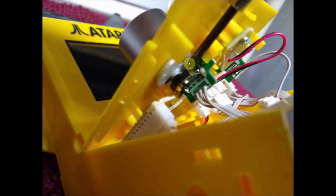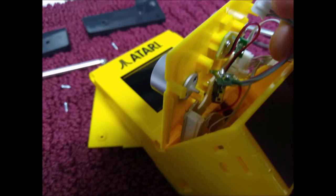And then I used a flathead screwdriver to slowly pry this down. Now what they did here, again, I originally tried to pry this off because I thought it was a clicky potentiometer, which it's not. It's actually screwed in from the bottom, very reminiscent of the arcade 1-Up spinner, where the spinner top has something underneath locking it in. So we have to basically just slide this off without damaging this little piece that comes out here. And it will come up fairly easy.